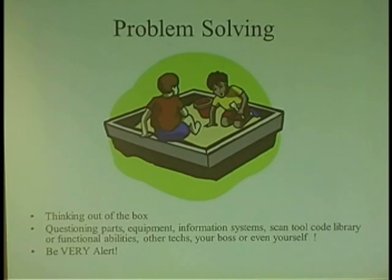What do you do in that situation? Had I not had a factory tool, I wouldn't know. And that's just one bug that's in that tool. How would you like to pull a code and it says right side seatbelt problem? So I have the guy rip apart the whole right side. I'm checking the voltage in the lines. I'm checking the sensor. I'm like, nothing's wrong here.